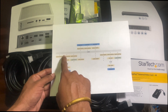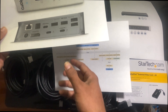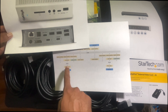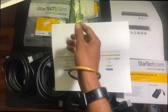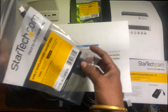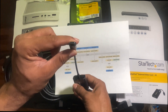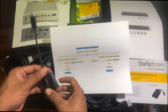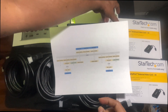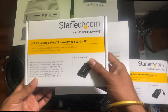On the input side of the KVM there are three DisplayPort inputs that connect to the dock station. Since the Caldigit TS3 Plus only has one DisplayPort, I need adapters for the other two connections. The first DisplayPort is used directly. For the second, I'll use a USB-C to DisplayPort adapter, which converts a USB-C port to a DisplayPort connection.